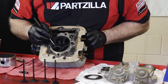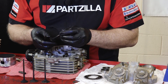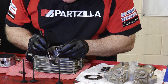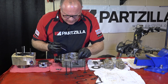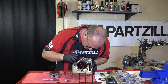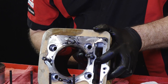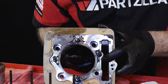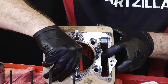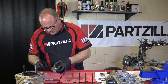What we're going to do when we reassemble is take a wire brush and clean out the combustion chamber, and then also take each valve over to our wire brush wheel and clean off especially the backside of the surfaces — because that carbon that builds up right there actually impedes the air flow, either for the intake or the exhaust. Let's take a look at our cylinder. I don't see any scoring; everything still looks pretty much the way it should. I feel just a little bit of a lip right at the bottom, so that tells me I'm probably going to need to take a look at that oil ring — everything up top looks good, but I don't feel any edge on the top of the bore. So let's start looking at our rings.